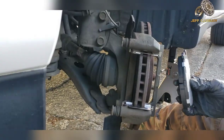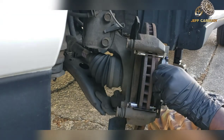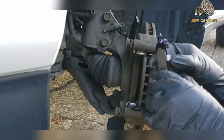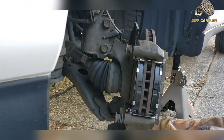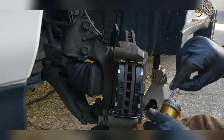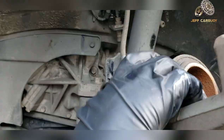After all the preparation, we're ready to drive in the new brake pad. The angle at which you removed the old one is the same angle you use to install the new one — approximately 45 degrees — then line it up and it slides into place without much struggle. The technique to install brake pads is almost the same on most vehicles. Apply a thin layer of anti-seize grease on the back of the brake pads to reduce squeaking, because that's where the brake caliper piston will be making contact every time you apply the brakes.